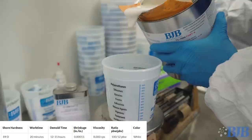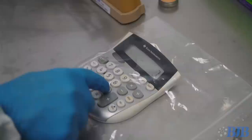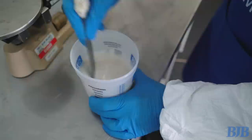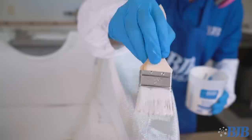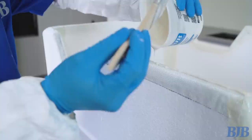Now that the thin strips of fiberglass are in place, it's time to mix up batches of the TC-1604 epoxy laminating resin. TC-1604 is a medium viscosity laminating epoxy designed for wetting out heavier fabrics, allowing you to create thick laminates quickly without excess draining. TC-1604 has been used over the decades in the aerospace and foundry industry for making dimensionally stable, heat resistant composite tools, drill and trim fixtures. But it also works great for general purpose layups, support jackets for silicone glove molds, marine applications, wood lamination, and even coating 3D printed parts as a sanding sealer. It features a 20-minute working time and an economically attractive price.